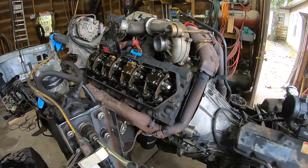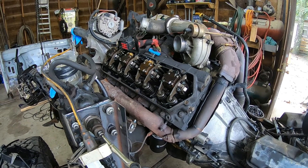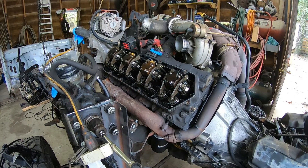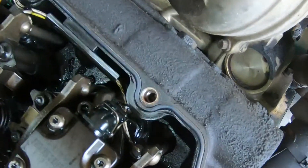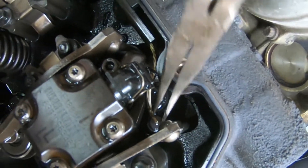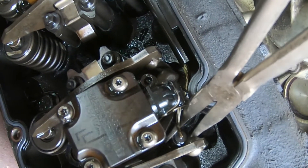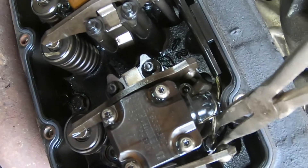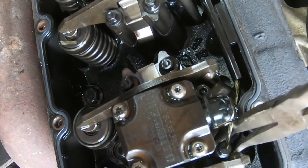I've got this side here open and ready to go. Got the valve cover off — I haven't disconnected anything yet. So to get these glow plugs, you've got a connector on them, and I've got this bent-type needle nose pliers. You just want to kind of grab the plastic part, not the wire — pull it up. Obviously you don't want to pull by the wire or you'll be changing it out.